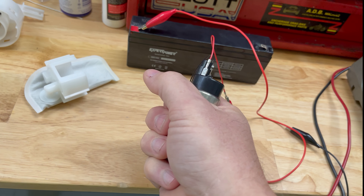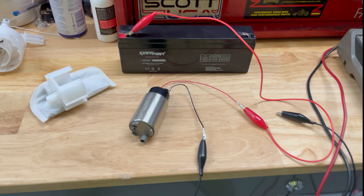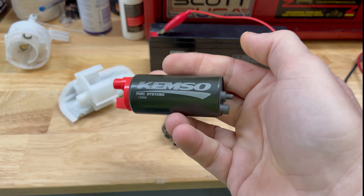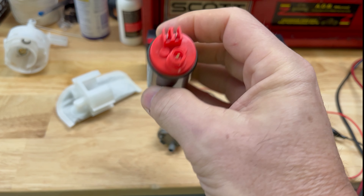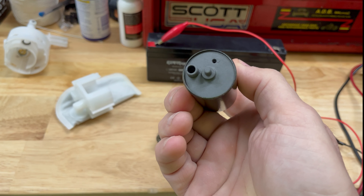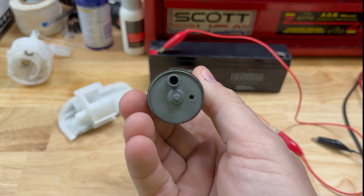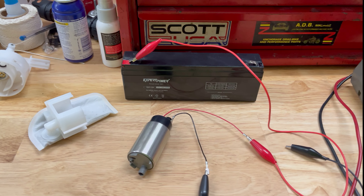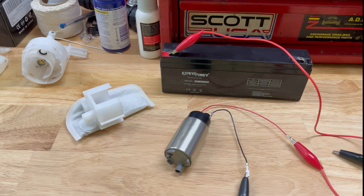She's a little warm — not hot but warm to the touch. If that's all it takes to destroy that motor, I'm not sure that's the highest quality motor we could have. I also have one of these guys which is an aftermarket, supposedly high-performance pump. Maybe we'll run this one for fifteen minutes and see if it gets hot, because I'm in a destructive mode — why stop now? So yeah, don't leave your key on for more than ten minutes when your fuel tank is dry. Otherwise you could hurt your pump.